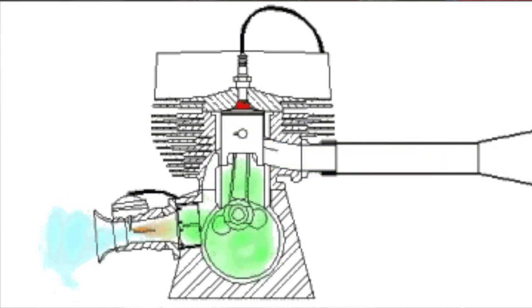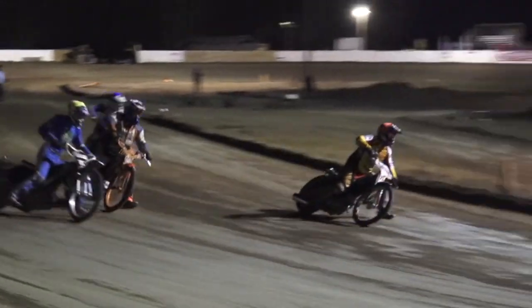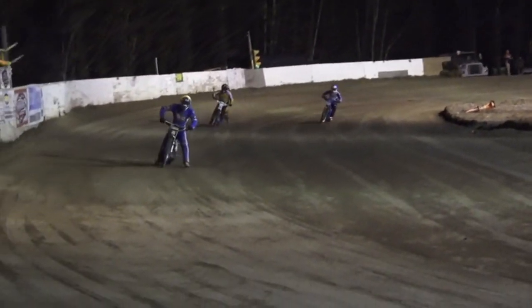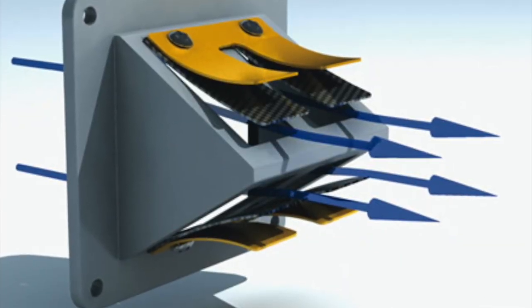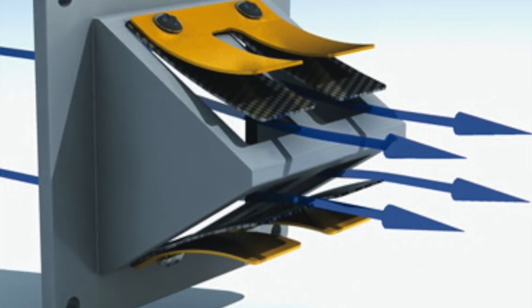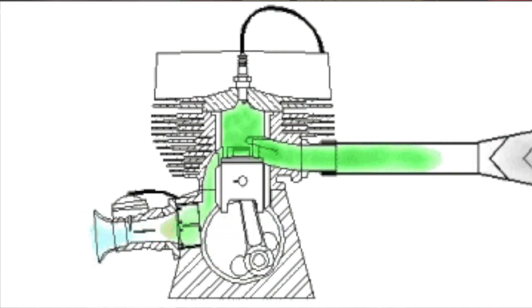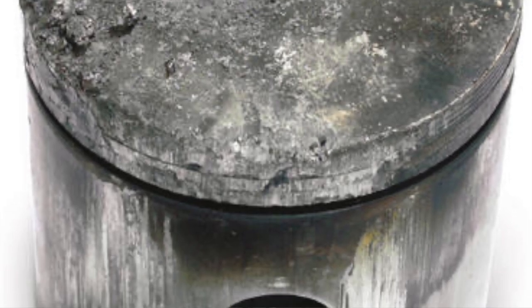On the other hand, increasing the height above the intake port — effectively moving the exhaust port up — will impact compression so badly that the bike becomes almost unrideable. Taking off material from the bottom of the port will let more unburnt gases escape. In extreme racing scenarios such as drag racing, exhaust ports are made tall and flywheels are lightened so the engine reaches power-making RPM very fast, but such a bike will barely move in the city unless you really ring the throttle. Semi-porting also means taking off material from the intake in some cases. A bigger reed valve means more air-fuel mixture entering the crankcase, however the negative pressure inside the crankcase might not be enough to open the reed and pull all the charge in. With both intake and exhaust ported, you will need better fueling and proper exhaust, so jetting is done to compensate the increase in air-fuel volume. If you do not compensate with bigger jets or bigger carbs, the engine risks running lean, which can lead to catastrophic damage.